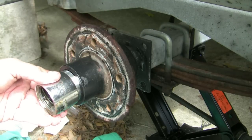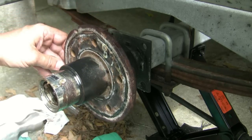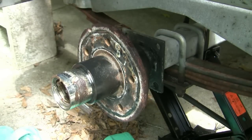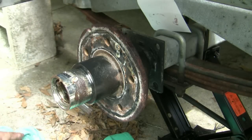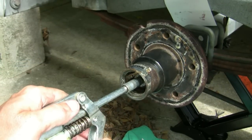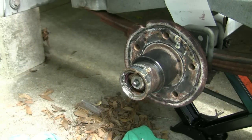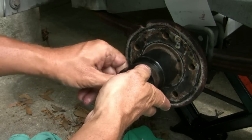Got that all cleaned up. We're going to tap the bearing buddy back on — okay, that's back on. Now I'm just going to use my little grease pumper here, pump grease back in. Click it on — there we go, it's on there. Just start pumping that grease. You'll see this start to push back after I really pack that grease in there. That's all the grease I'm going to put in there for now. Put on the little cap and we're good to go — done!